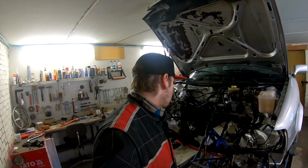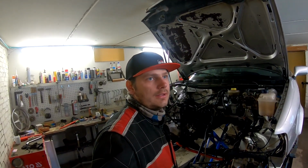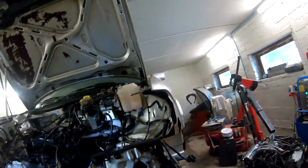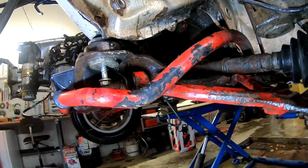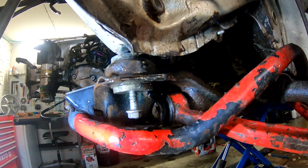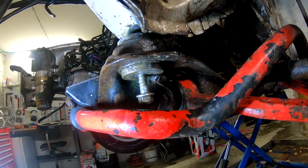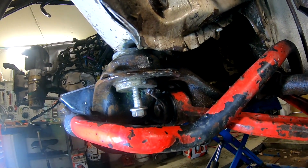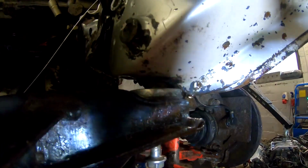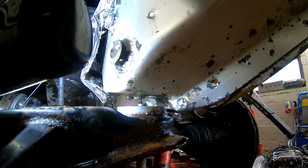So I had a little wash on the engine bay, but nothing too big, because yesterday when I removed the engine I discovered one big problem in this body. I will show you. So the first issue is that one axle bolt actually was a bolt used in concrete, and after I discovered it I started to look what the problem is here, why a concrete bolt is used, and then I discovered that the original mount of the axle is 2 centimeters to the interior side.